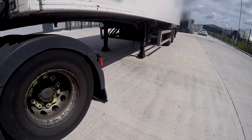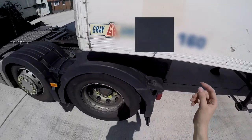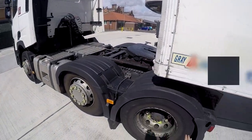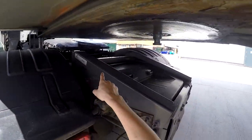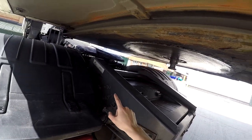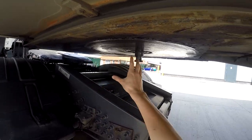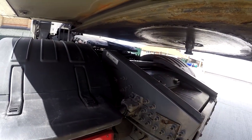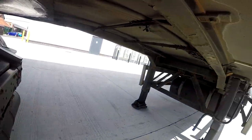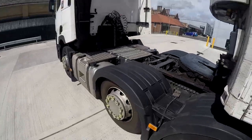We're fully uncoupled. Now, the other reason why you want to put the legs down and then lower the suspension before you come out is so that the trailer doesn't drop onto these bars. As you can see, there's plenty of grease around where the kingpin goes and where the fifth wheel is, because that's where it pivots. You'll get a load of it on here, and you can also damage them. So yeah, it just sets it at a good height — nice and peaceful and calm and controlled.